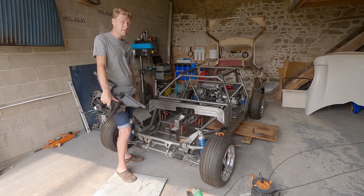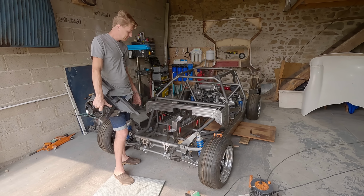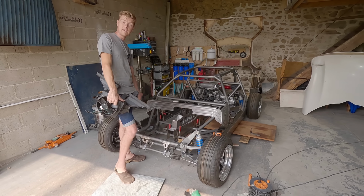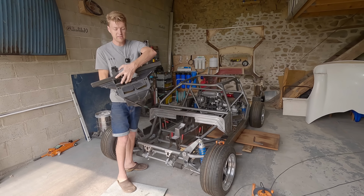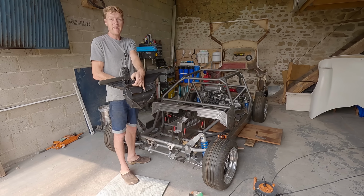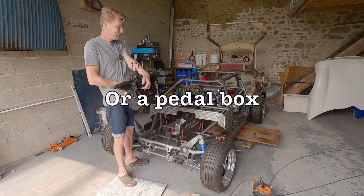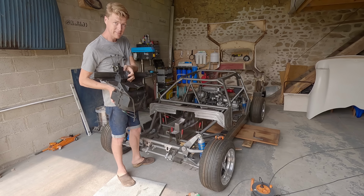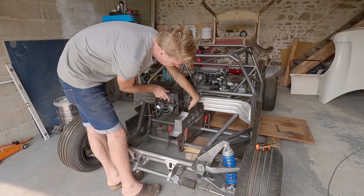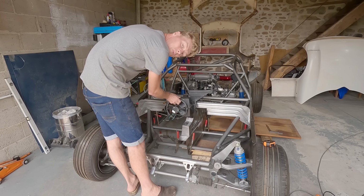I've been working on this car for 2 years, staring at this heater for 2 years, and I haven't seen it. It's not in my plans, nothing. And yet I've just said to Dad, and I've just said to you, we need to make a little tiny heater vent that goes in there to blow into the passenger footwell, because the passenger side foot blower is in the centre tunnel, and yet the passenger isn't the person that has size 12 feet, the driver is, right? So why don't we centre the heater with the tunnel like this and move the driver's side foot blower into the tunnel and make a little vent. And then that way the heater is completely out of my footwell.